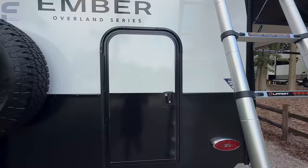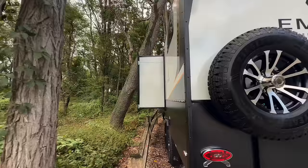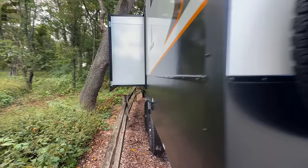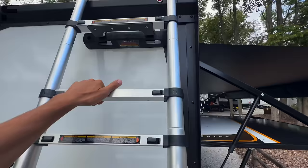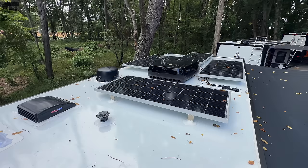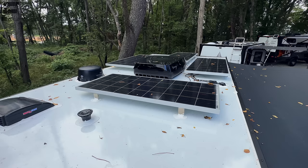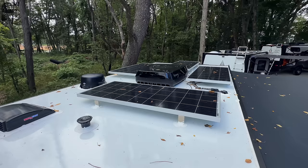Along this side, you have a cable-driven slide out and a 30-amp power connection. Up the retractable ladder on the roof, there are 800 watts of solar. Combined with a 3,000-watt inverter and a 270 amp-hour lithium battery, all of this is going to do things like run your AC on the RV. The way I explain solar: solar panels are like a fuel pump, and batteries are like your fuel tank — you need a good fuel tank size to run lots of components for a long period of time, and the amount of solar determines how quickly your battery replenishes.